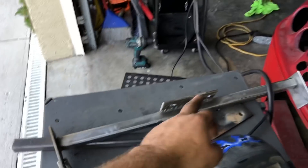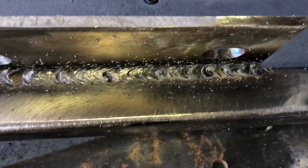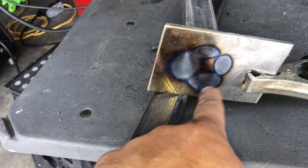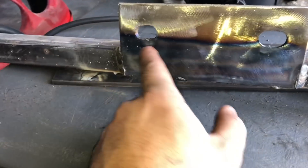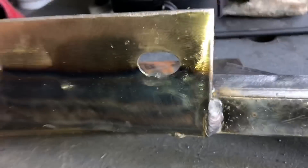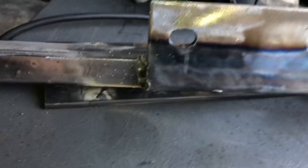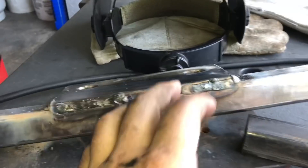About 70% of it is welded now. The part that goes to the differential itself and the passenger side frame rail are already done - came out pretty good, obviously it's flux core so there are bits and pieces everywhere. One thing I really noticed: since it's square tubing I couldn't do one continuous weld, so I had to stop and go around. But you can see how the heat distributed consistently on the flat piece, which is a good sign it's actually penetrating evenly. I got the sides done too - the first weld I tried doing a continuous bead instead of my normal circles for the dime effect, and I really didn't like how that came out.